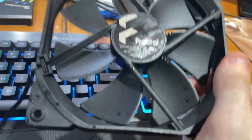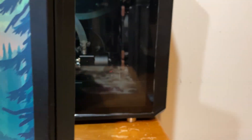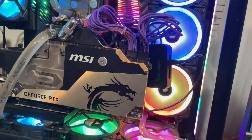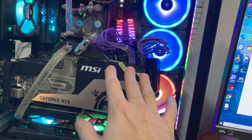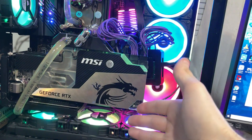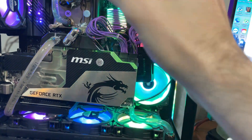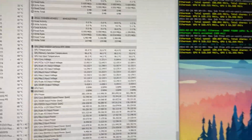Long story short: from 1000 to 1500 RPM there's a big difference; anything beyond 1500 is a waste of time. What I'm going to do is take the 3090 and put it back in my gaming rig, since temperatures are much better for backplate cooler testing. Then I'll do the parallel versus serial backplate cooler testing on that machine, which can detect the temperature differences much better.